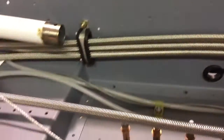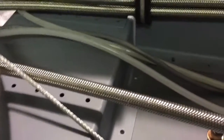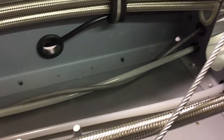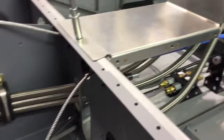Even though I'm making these videos, I still do maintain my online builder's log. This gray cable right here is the elevator trim electrical cable. I didn't have to clamp it — I just twisted it around this brake line and that holds it secure. It holds it to the bottom of the floor out of the way of the control stick, and then through a grommet up through the center console and up to the trim switch.